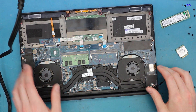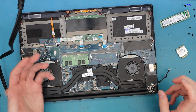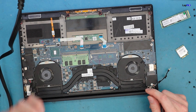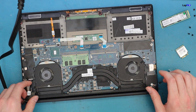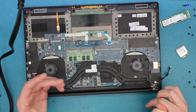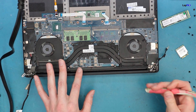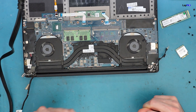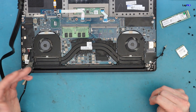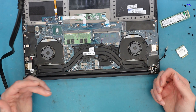It's very hard to say what the problem is. The CPU and GPU getting warm usually indicates some type of data issue. It could sound like a RAM issue, but we tried different RAM and confirmed that's not it. The slots look good with no physical damage. We did some research on this IC chip — it's getting very hot — and found that other people who replaced that chip still got the same problem.